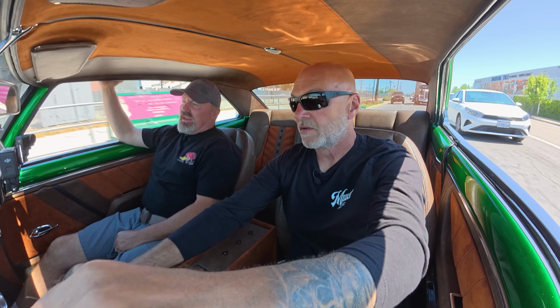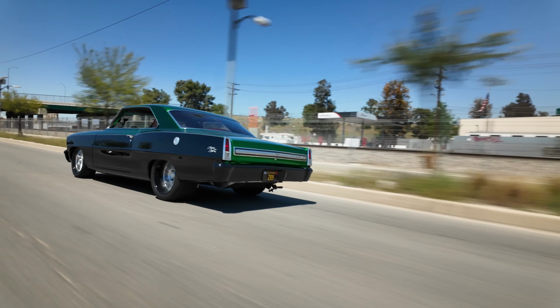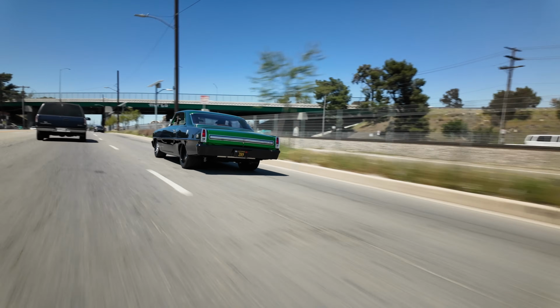On the rear end, it's got a TDS 9-inch with a Currie pumpkin in it, 3.89s with a Wavetrac posi, 35 spline axle. And it's definitely got the Black Widow mufflers, 3-inch exhaust with Black Widow 300s out back. And she's loud when you open her up. She's not a quiet one. Nah.